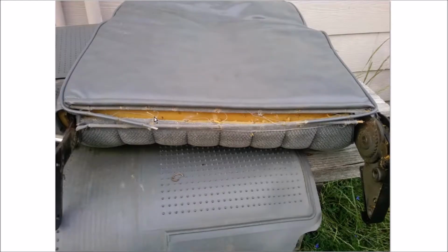And you can clearly see after getting all those hog rings off, there's the wire here going through this bit, same here. And those hog rings, if you've got a nice pair of diagonal cutters that are sharp and meaty, you can just clip those things right off. As you can see by this one down here, I unbent them with two different pairs of pliers, and that was not very easy or fun. Definitely possible, however.